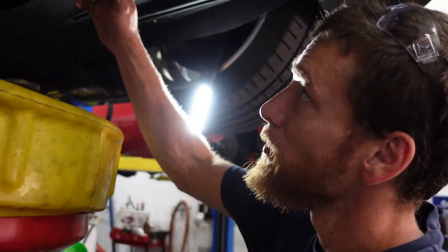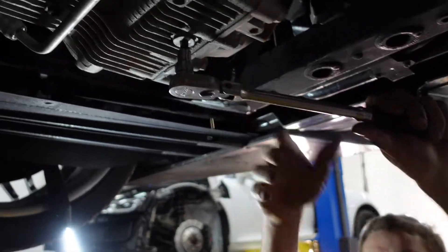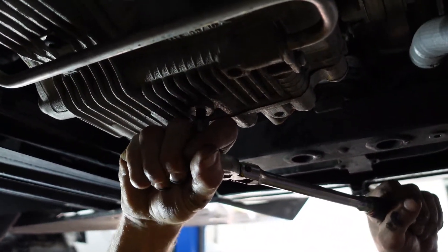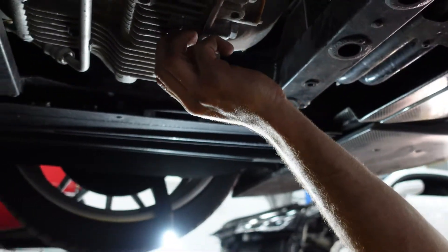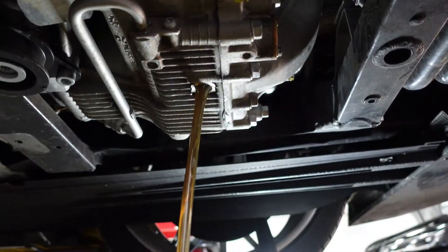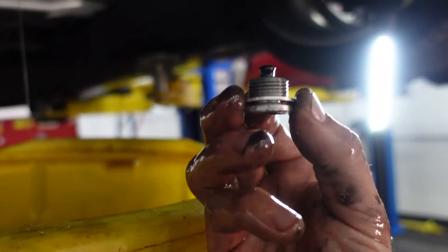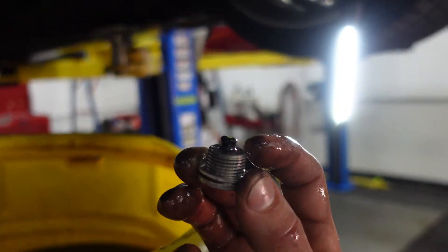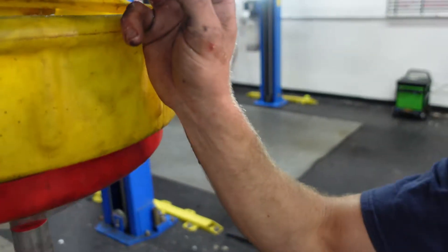When we're refilling, once there's a current flow, we know we are good — this will be the drain. We have a clean pan to make sure we know the amount of fluid coming out of the car. This should be a high flow here. We always have to pay attention and inspect the drain plugs — the magnet collects the metal inside the differential. This looks pretty good.